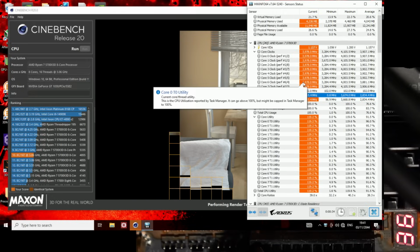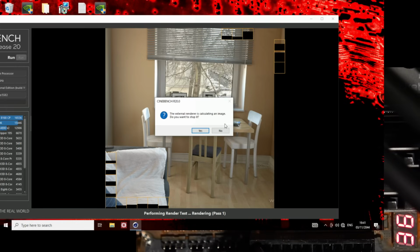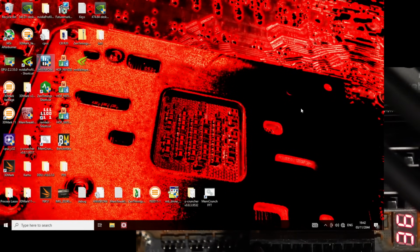So yeah, 5700X3D is like it is locked down. Or well, it's not so locked down that if you want to run some purely academic experiments like, hey, can a 5700X3D run Cinebench at 4.2 gigahertz? Yes, it can, but the rest of the system becomes completely unusable at that point because of the massive BCLK overclock. So it's not as locked down as non-K Intel CPUs, because with non-K Intel CPUs you set the BCLK above like 103 and the CPU literally refuses to boot up.